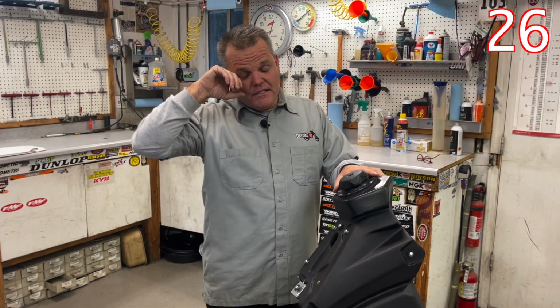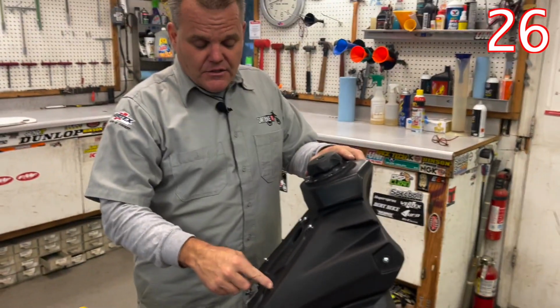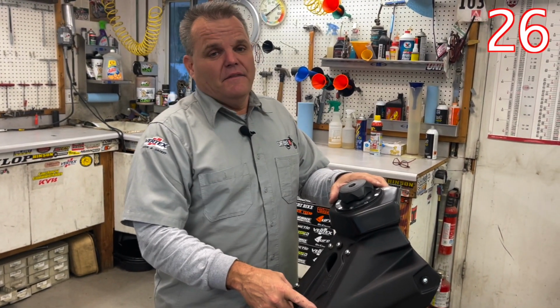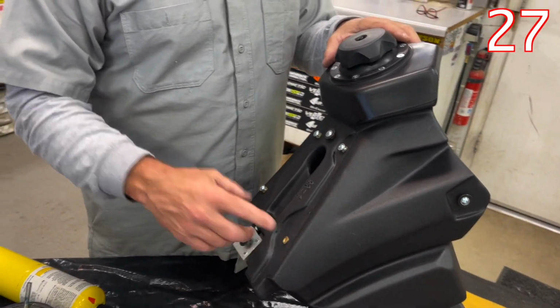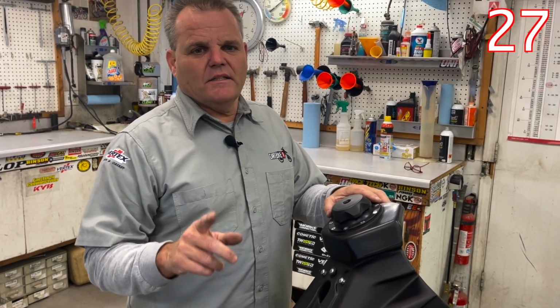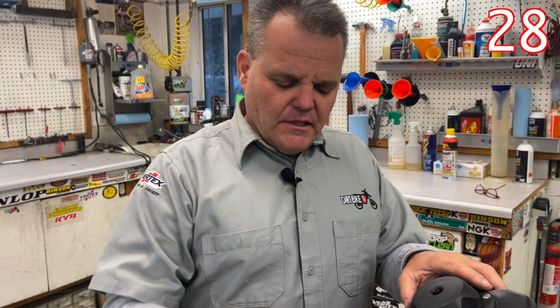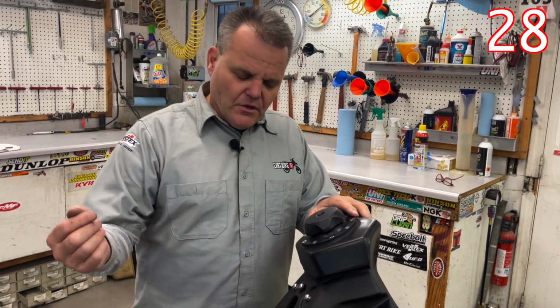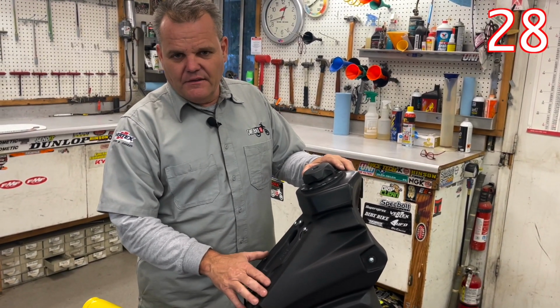And we've had some really interesting, I've had some guys help me. There are some ways where if the actual insert comes all the way out of the tank and there's still room there, then you can fill it with epoxy, like a Bondo. You could fill it with Bondo, drill a little hole, and then use a screw, like a KTM screw. You could put a screw in here and hold your shroud on. So that's one tip you could do. Some guys will actually then just drill up this and fill it with like JB Weld or Bondo type stuff. JB Weld stuff would be better, anything like that, a putty, hard deal. Let it set up. A resin kind of deal where you can drill it out with a small hole and use a screw then from then on. So that would save you from having to get a new tank if you did that.